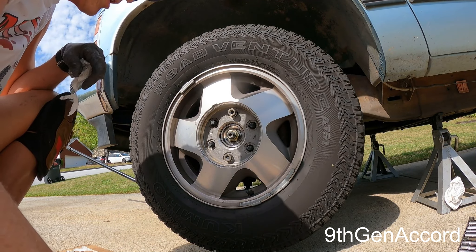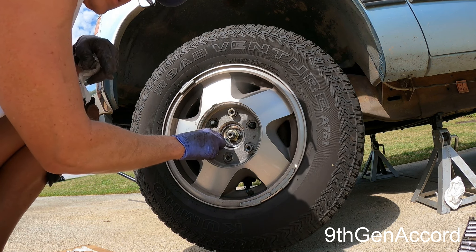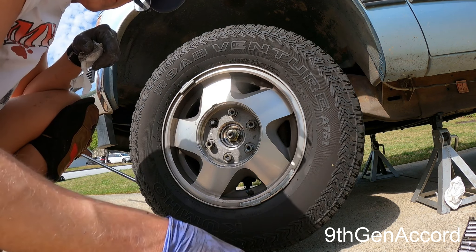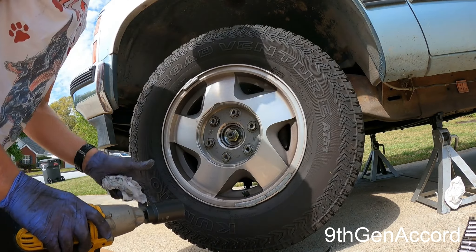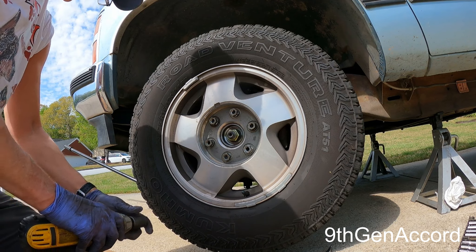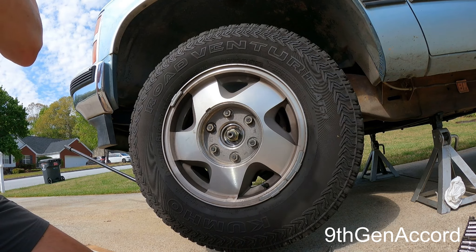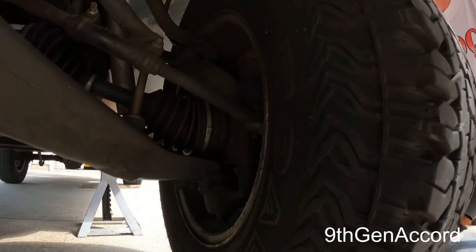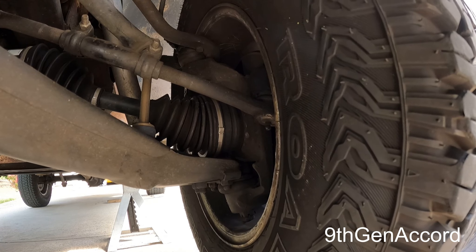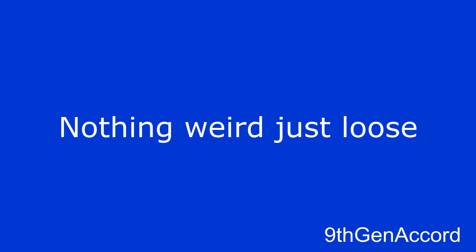I was going to show you guys a little trick — the garbage truck decided to stop in front of my house — but instead of having to lift the wheel up, if you've got big wheels and tires, especially on a four-wheel drive truck with some substantial height to it, you can get the wheel kind of in position and use a giant crowbar to lever it up. That way you don't have to try to lift it with your back or hands. When the wheel is touching the ground, torque the lug nuts. Listen — nothing. Tight as a drum. I'm going to take this wheel bearing over to examine it better, and if I find anything weird, I'll let you guys know.